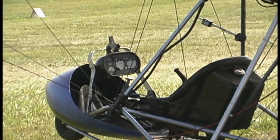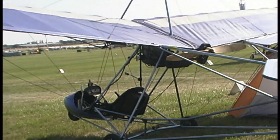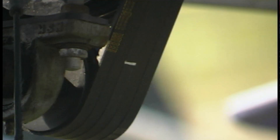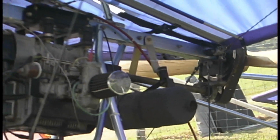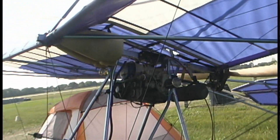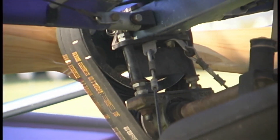The whole sail is a custom-made sail. You had new sails done? Yeah, I had new sails done — they look real fresh and good. These are Dacron sails, like a sailboat sail, sewn together — you can see the lines of stitching. It's a very durable surface, makes a great wing, but it's subject to sunlight degradation, so you need to punch-test them periodically. I put new ones on just to solve that problem. And I've got a custom-made rudder too — I've got Snoopy on the tail. I'm known as Snoopy.